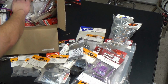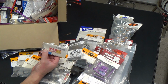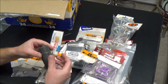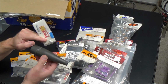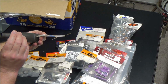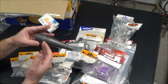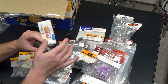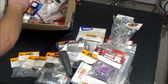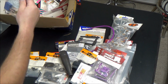Some screws. This is the back pressure valve. I'm gonna want to put this on my pipe, so I'm gonna have to drill and tap this fitting, for you nitro guys. You know what I'm talking about. You put this on here, and as the exhaust flows out, it's gonna put pressure. I'm gonna have to find out. I think it's before. I think right here is your baffle or whatever you want to call it for your actual muffling. You put it before that, so it builds up your back pressure, shoots this over to your fuel tank, keeps a positive pressure through your fuel line, and then it'll go into your carb.